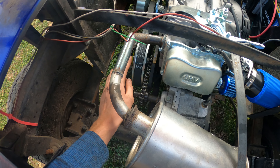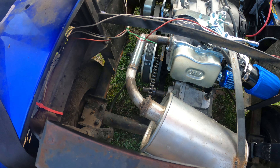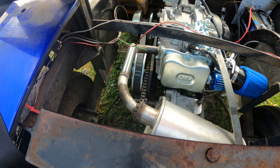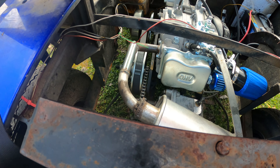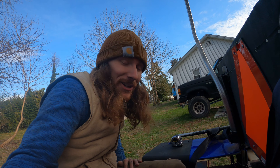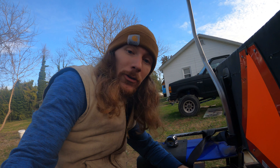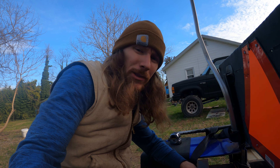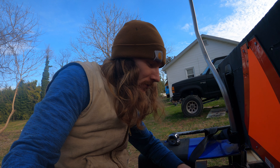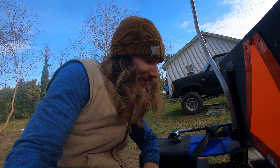Then I could always play with the rear sprocket because those are easier to find. This one got set to a specific size because originally this thing had a belt drive on the jack shaft, but I wouldn't be able to fit the 420 engine in without doing what I've done. I mentioned this would take some playing around and it's gonna take some playing around. What I'm gonna try is to find the smallest rear size I can — probably a 10-tooth — order that and double the front sprocket just to flip the ratio and see what happens. Couldn't hurt, right?